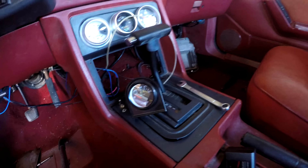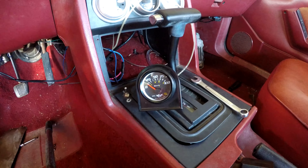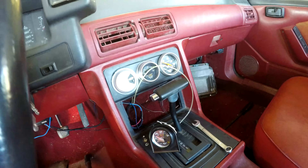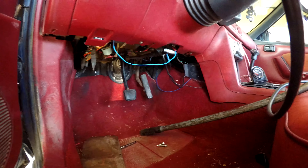Although it was running and it sounded quiet, this oil pressure gauge is still showing only 25 PSI whether cold or warm, which is obviously not good. We purged a line and tried to get all the air out — there's a bit of air left. Maybe this thing has a leak. The last time we had it running it sounded like it was ticking a bit from the lifters again, and through the hole in the firewall we could hear it. So that's a little concerning. The gauge we thought might just be faulty, but it was actually making lifter noise again. That would be really bad. So we're about done tuning for today.